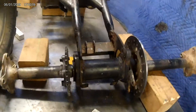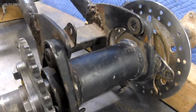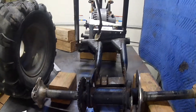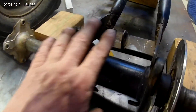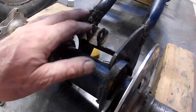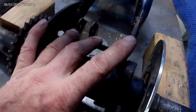But I have some repairs to do first. The threads are all stripped on this mount for the axle, so I'm going to have to take this apart — also because I have it assembled backwards. I have the long side here and the short side here, and because of the way the chain is going to go, we have to flip this axle and fix these bolt holes because they're all stripped out. Maybe I'll make a small video — you'll learn that in trades training — but I'm going to show you what we're going to try to do to fix these holes.